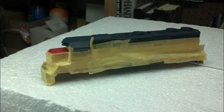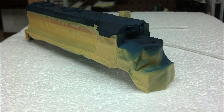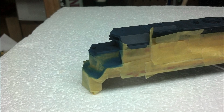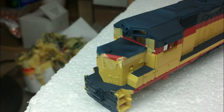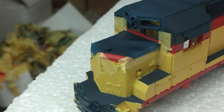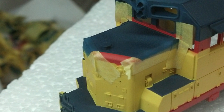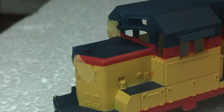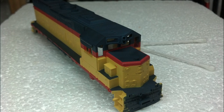It looks like we're good and ready to paint. We got everything covered up and went ahead and shot paint on this one — I think I used three coats, hitting it three different times and allowing it to dry well between each coat. Now this is cool — take a look at this. This is what it looks like when you start to untape it. You can see that nice clear line. When you have your tape pressed down the way you want it, that's the way it's going to look when you peel that tape off slowly. Hold your breath, YouTube — here it comes. Boom! There you go. Don't that look good? I was really happy with the way that looked.